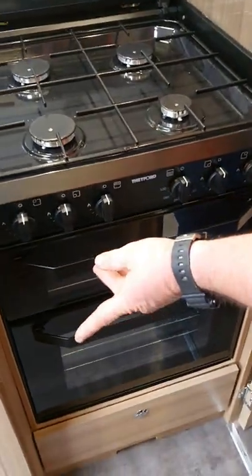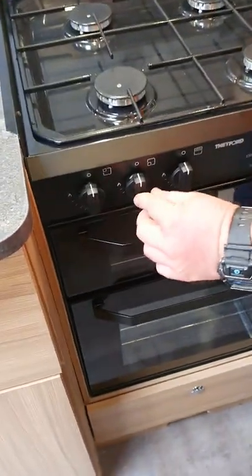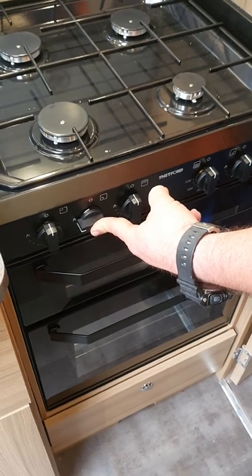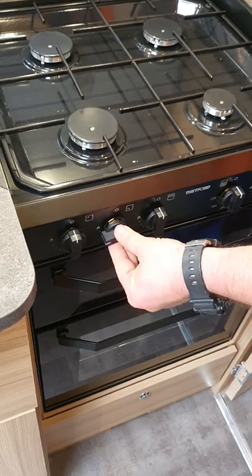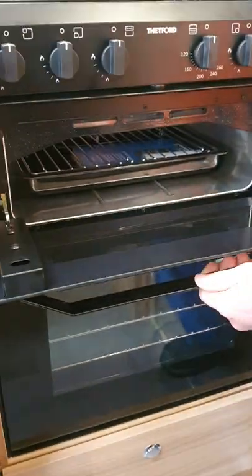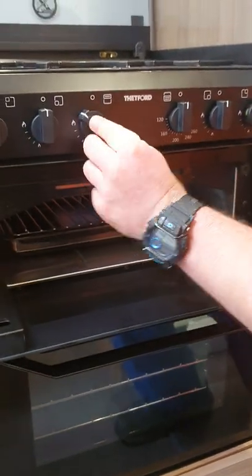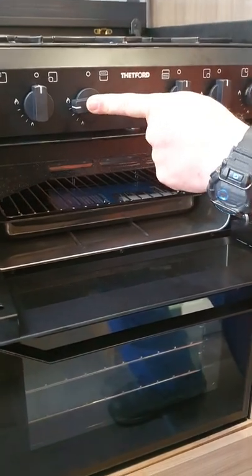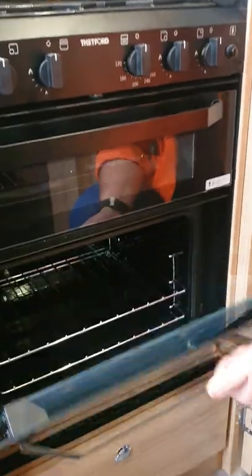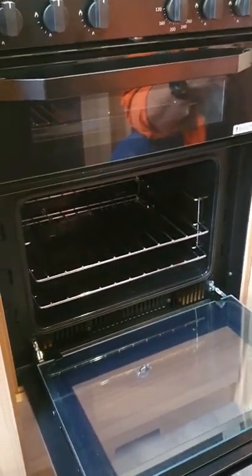For your actual controls for your oven, you've got this one and that one, and these two here are your controls for the top. Very similar to a barbecue — push and hold and turn. You then have your igniter on the right-hand side here, so hold that in — that'll spark and get your gas flowing through. Once it's going, let go of the button and adjust your temperature from there. To turn them off, just back to zero. You also have your grill — that opens up there. There's a little tube rail along there. Push, turn and hold, hit the igniter, that'll kick your gas in, and once it's going, adjust your temperature. Your oven is very much the same — there's a rail along the back that you'll see the gas ignite on. Press the button in, turn and hold, ignite it, and then set your desired temperature from there.